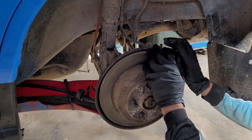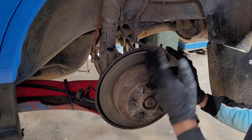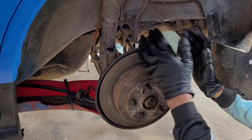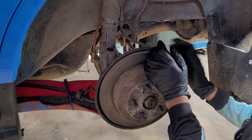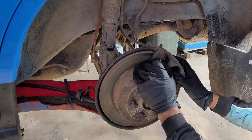Why would you use a hydraulic handbrake over the mechanical braking system? Why take out the secondary redundant system when it works effectively? In a road car, you absolutely shouldn't remove the mechanical handbrake. However, in a rally car we need braking to be quite efficient. Mechanical handbrake systems are not brilliant for multiple uses - they're designed for parking or emergency situations. If you keep pulling the handbrake on a rally stage to get around tight corners, you can stretch the cables or wear out the mechanical components.